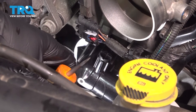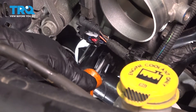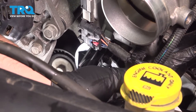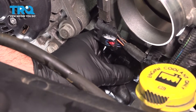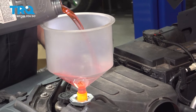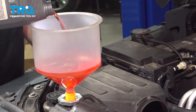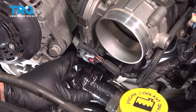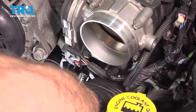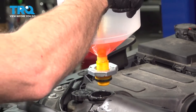Before we put all the piping back in place for the intake tubes, I'm just gonna take a straight blade screwdriver, loosen up the bleeder right here, putting it in sideways. Once you get that turned a couple times, you can do it by hand — just loosen that up. We're gonna top off the coolant using a funnel and the appropriate coolant. Just top it off. You're gonna hear air coming out of that bleeder. Once you see it leaking, you can close it up and just snug that up a little bit.